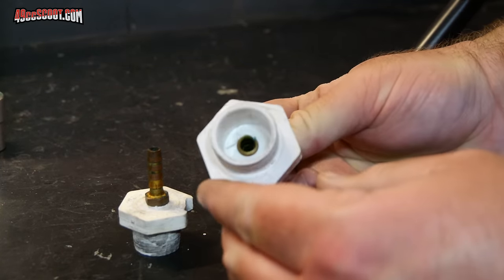1/4-inch hoses will do just fine, and 1/8-inch NPT has plenty of opening to get all the air you need in there. Just be creative when putting this kind of thing together — it doesn't have to be these specific adapters. It can be anything, PVC or metal. You just need something that goes into the intake, will seal up so you can clamp it down, and has a fitting so you can pump in pressure.